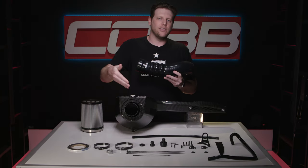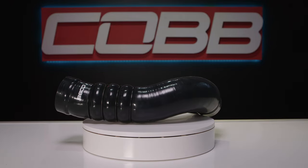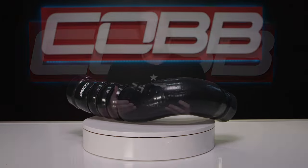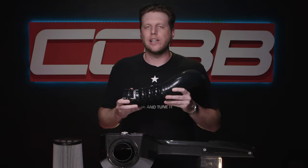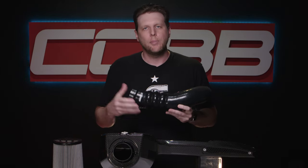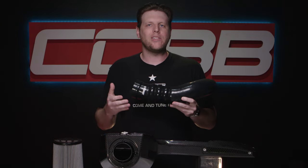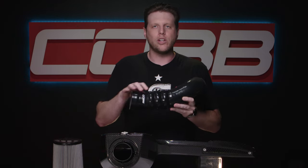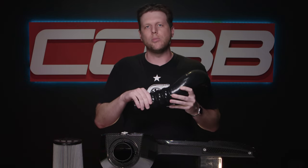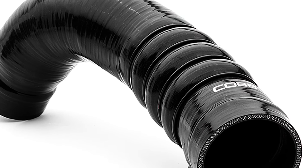Connected on the back side of the velocity stack is this beefy inlet tube. It's all one solid piece that connects directly to the turbo, and we use very sturdy multi-layer steel wire reinforced silicone on the back half here so that air flows consistently inside and it's really strong to avoid collapsing on cars with aggressive tuning and a lot of boost. But these engines move around a lot under the hood when driving hard, so there needs to be some compliance between major components to avoid leaks and damage. This portion allows for it to flex along with engine movement, and we add these black steel rings as an external reinforcement to prevent it from collapsing in this area.